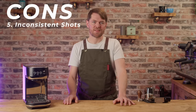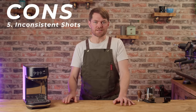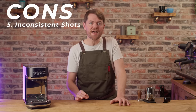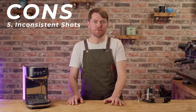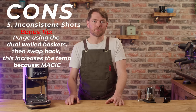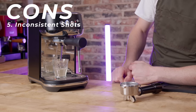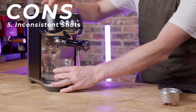Con five: inconsistent first and second shots. I get emails asking for help with this — usually the first shot seems okay but the next shot at the same grind size takes much longer, or the first shot is under-extracted so they change the grind slightly and the next attempt chokes the machine completely. The cause is that the tiny thermocoil heats up in just three seconds but everything else is stone cold. Workaround: do the preheat flush for longer. Make sure you flush with the portafilter in place and a cup below, so you're warming everything up including the cup.